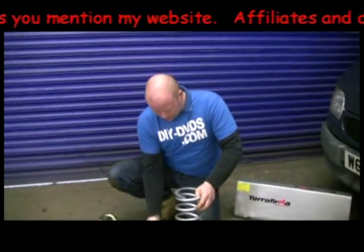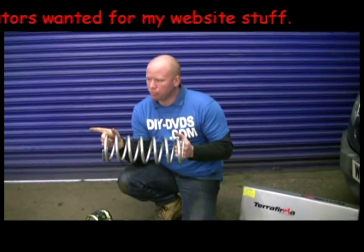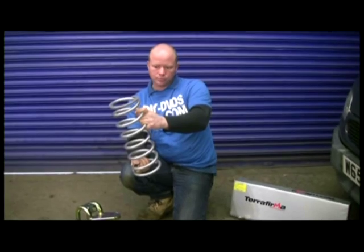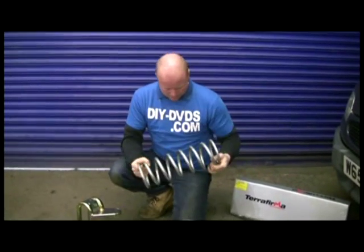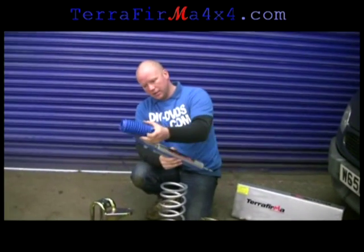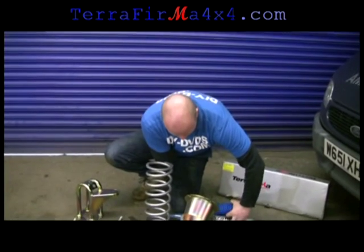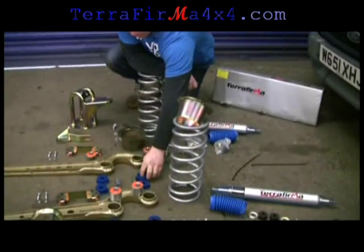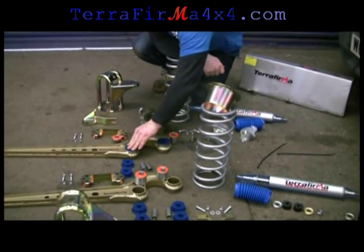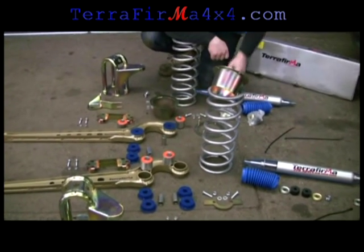Another spring clamp to hold one end of the spring down. Front springs — we're doing a 110, I should say. So the rear springs are considerably more meaty than the front ones. These are 50mm, same as the others. Lovely colour again — smart looking bit of kit. Same shocks for the front, Pro Sport long travel. Love the blue gator — it's going to look smarter with two together on the front. Bushes for all of them. We've got Polybushes to go in the already caster-corrected arms. Hopefully a bit of grease will get round that. Any problems, we'll let you know.